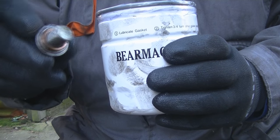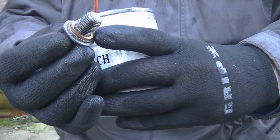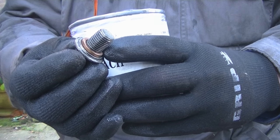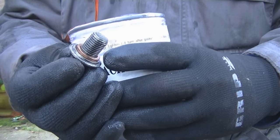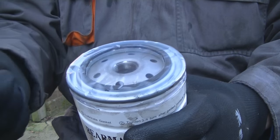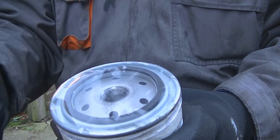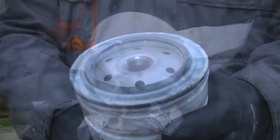The other thing you need is a new collapsing washer for your sump plug. It's pretty important that you change it when you do the oil. If you don't, all you get is a very slow drip, drip, drip leak. It's a copper or brass collapsing washer — as you do it up, the metal physically collapses, giving you a greater seal. The oil filter comes wrapped in cellophane so no debris gets in, and it comes with a rubber seal. Just put a bit of engine oil on it to lubricate it before you fit it. Remember to change the sump collapsing washer — and that part of the job is pretty much done.